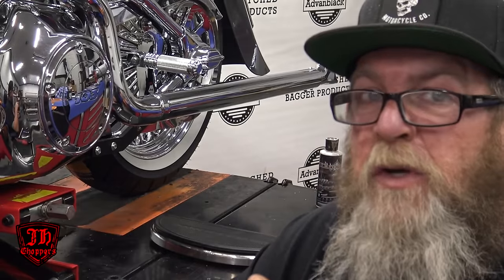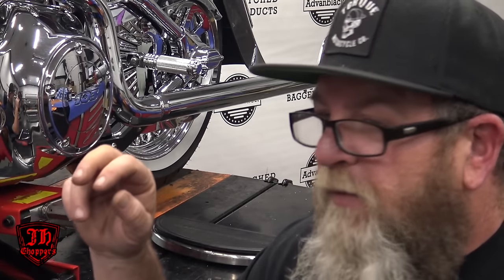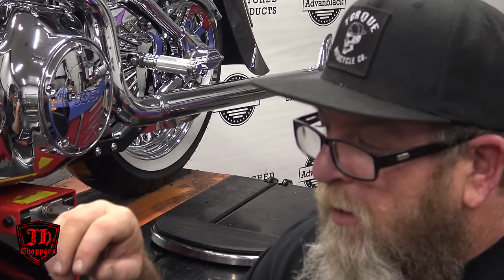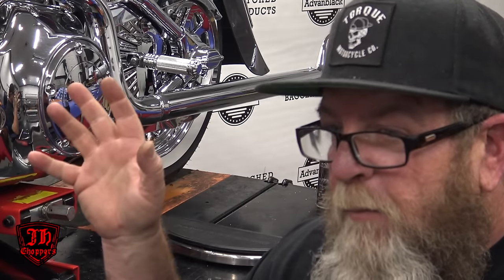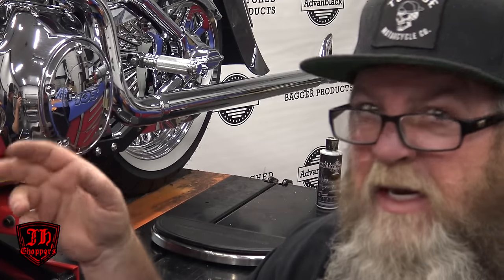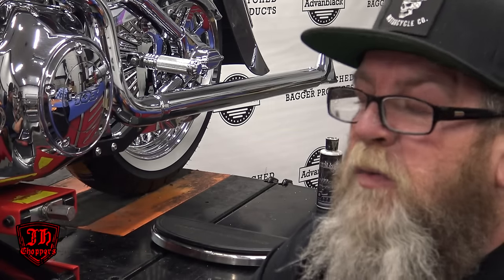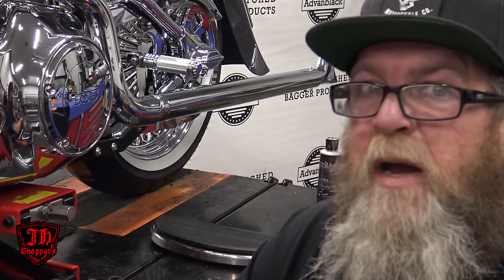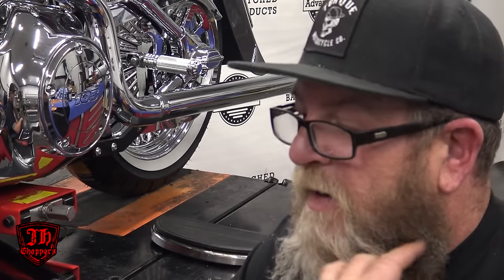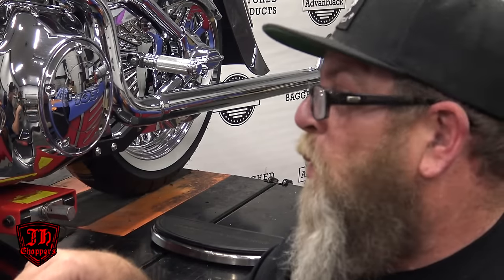Right here underneath the floorboard you're going to see two bolts, one on each end. Get your Allen wrench, slide it in there. Flip the floorboard up, pull that last bolt out, and that floorboard will come right off. Now, if you want to know the torque specs on your bike, I highly advise — especially if you're going to be doing any wrenching — get a service manual for your bike. You don't have to buy the $150 book from Harley-Davidson. Just about every model of Harley-Davidson has an online PDF version of the service manual, which is completely different than your user manual. The service manual gives you step-by-step instructions, torque specs for everything — and that's what's most important.